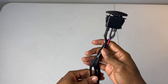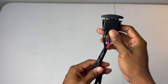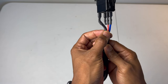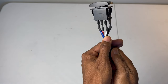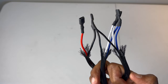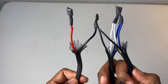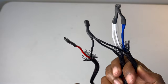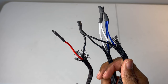The wiring harness has two plugs for the lights, a power and ground, and a switch. It is a three-position rocker switch which allows you to select white or amber light. I'm using the factory auxiliary switches so I won't be using it. The red wire and one of the black grounds power the switch so I'll just cut those wires off. The two white wires and black ground power the amber light; the two blue wires and black ground power the white light. The plan is to tap the blue wire - white light - into the hood light bar, so when the light bar is on the cubes project white light. The white wire for the amber light will go to my available auxiliary switch so I can turn on the amber lights independently.